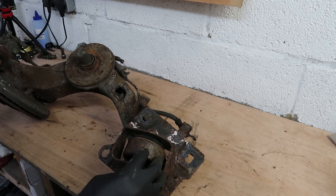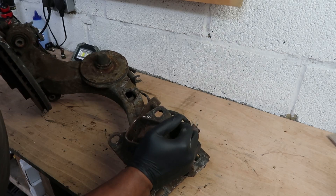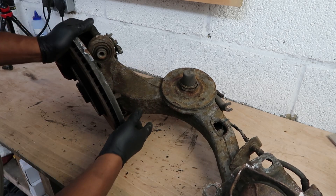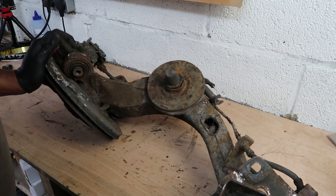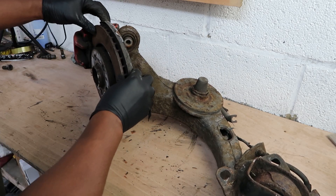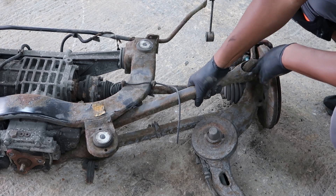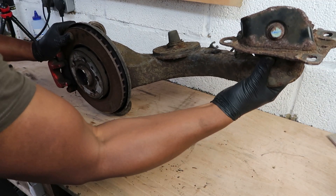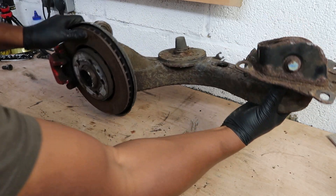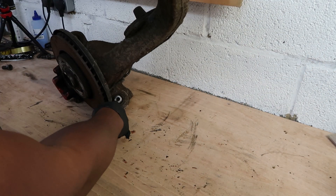These are the main points of failure here, and they are a bit of a tough job to do, but they're still very doable. It's a bushing. If you look here, this is another bushing, and there's one at the bottom as well. These are what your control arms go on to, and they hold your wheel in this orientation - so this holds it more up and down, and then the arms here stop it from moving laterally.